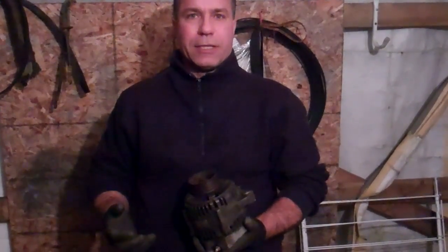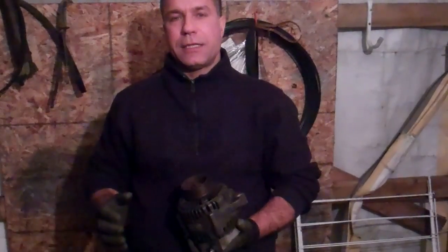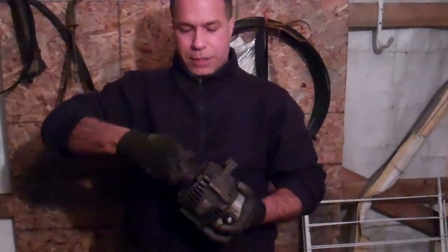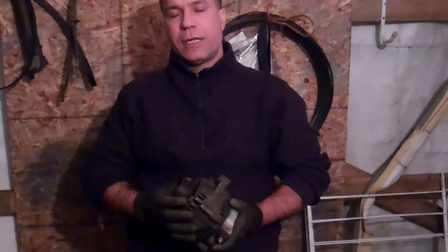What I'm going to do in the video today is we're going to have a dead battery in the vehicle. We're going to start the vehicle, take the dead battery out, start the vehicle with a fully charged battery. Then I'm going to remove the cables from our charged battery, so you'll see that the vehicle is still running even though there's no battery connected. That illustrates the function of this, because at that point everything in the vehicle is being run via the alternator, which is turning with the belt run by the engine, and it'll be generating all the current that the vehicle needs.